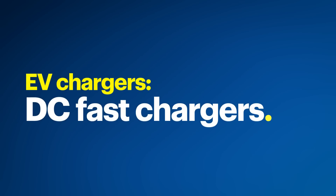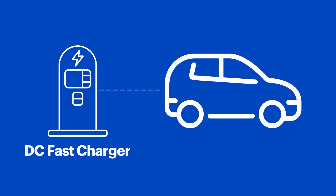Finally, there are DC fast chargers, sometimes referred to as Level 3. These aren't currently available for home use, but can be found in commercial spaces via useful apps, including those that come with the vehicle. These are the fastest chargers available. They use a special connector and can charge a battery up to 80% in just 30 minutes. These are great for long road trips, when you need to recharge quickly, or if you don't have an at-home Level 2 charger but can easily visit a DC fast charger near you. Note that not all EVs are compatible with fast charging, so check your vehicle specs.